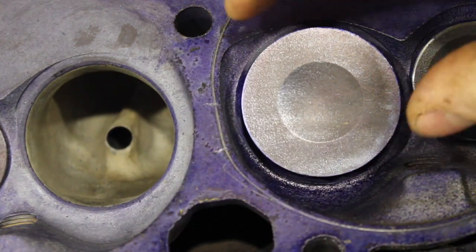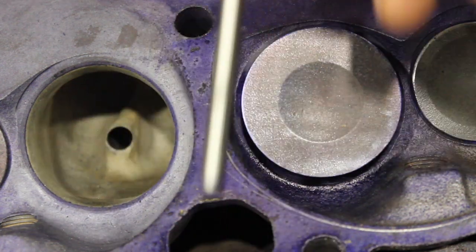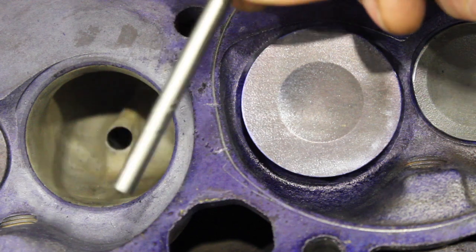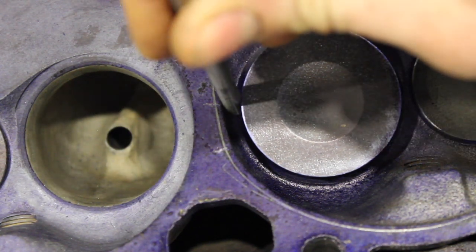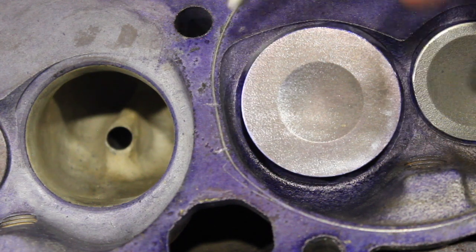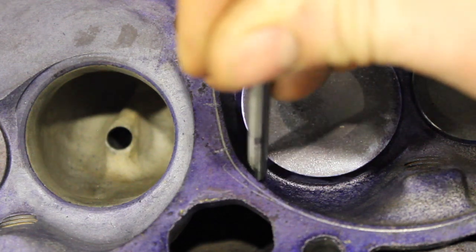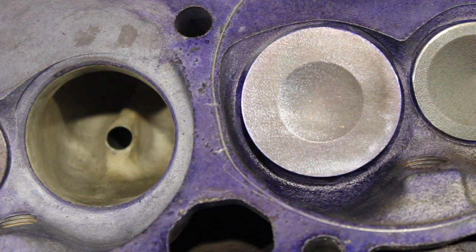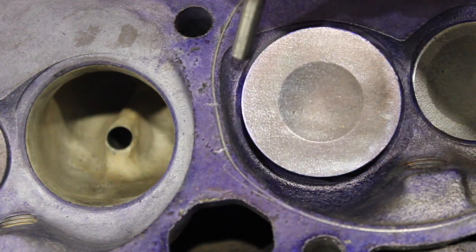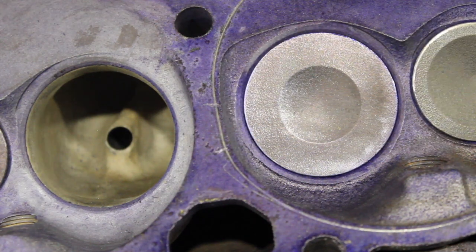I made two little marks here. We're going to open the valve up approximately 500 thou, and I'm using just a quarter-inch piece of metal dowel — nothing fancy, no porting balls, just something you guys can easily find. I'm going to bring it around the valve until it hits the valve and I can't make any more sweep around. That's one contact point — make a mark there. Then you're going to come around the other side, same thing, and make a mark there. In between these two marks is where we have to clean up to unshroud this valve. The machinist dye is nice here because as you're grinding, you can see where you're taking material out. We're going to do the same thing on the exhaust side as well.